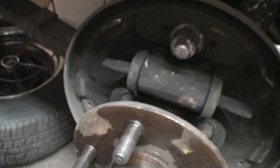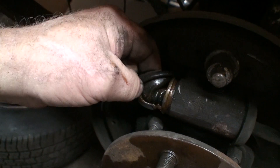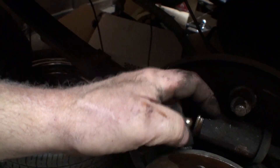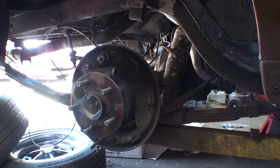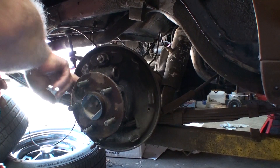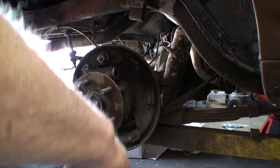You're about to see why I gotta do the wheel cylinders. I open this up and there's fluid there, and rust and junk. These actually aren't that old, but it sat so long that it must have got moisture in the brake fluid. I just need to get these four bolts off, and they provide this nice little hole here. Let's just see how tight everything is — it shouldn't be that bad.